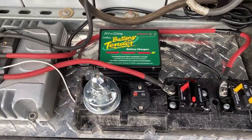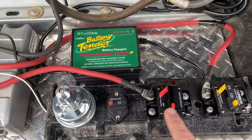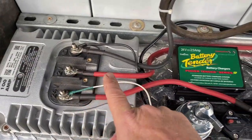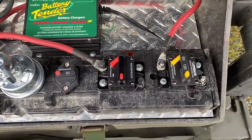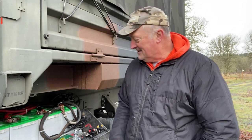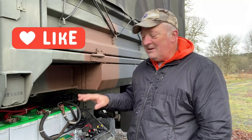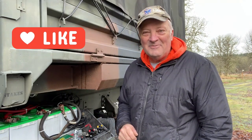Time to update you on some of the progress. The 24-volt is going to the aux side of the 80-amp circuit breaker, and the 12-volt is going to the aux side of the 120-amp circuit breaker. No power has been hooked up yet to the battery equalizer — I'm going to save that for another day. The weatherman says it's going to start raining, so next time I'll be finishing up this battery project, putting in the battery disconnects and having all of this stuff buttoned back up.